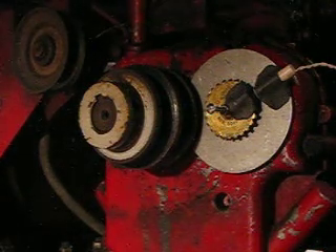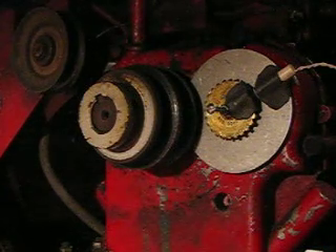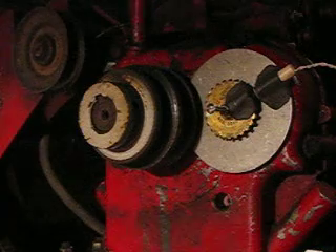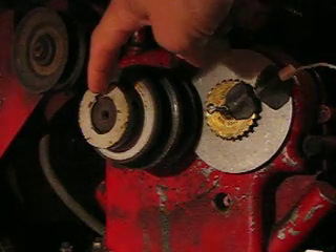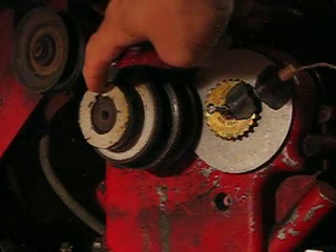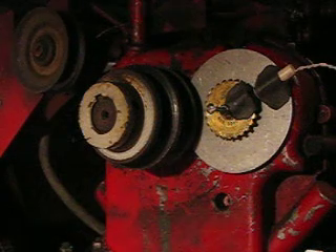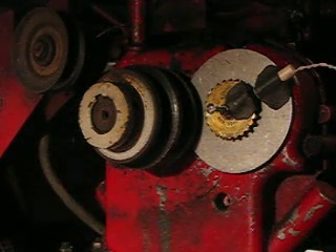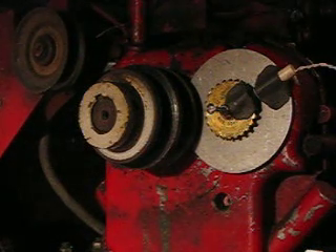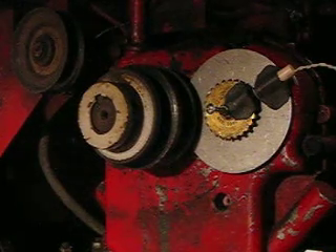What I'd like to show you is how I got rid of the waste spark. Now if you notice, the flywheel, which is behind the engine, is directly off of this output shaft — the same shaft. Watch this key and watch the magnet here: the key on the output shaft will go around twice, but the camshaft magnet will only go around once.